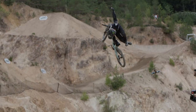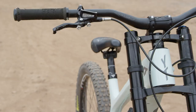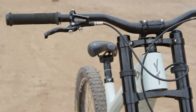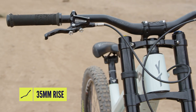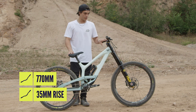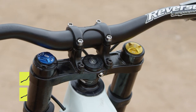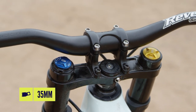You don't want that bike to kick up the ass when you're hitting jumps as big as this. Up to the handlebars and the cockpit area of the bike — as you can see, he's got a very high front end on here. It's not just deceiving angles. He's got a 35mm rise bar from Reverse Components, cut down to 770 millimeters. That's quite precise. He's also using a 35mm stem, and underneath it he has two 5mm spacers and one 10mm spacer.